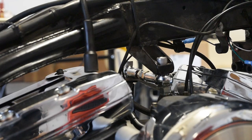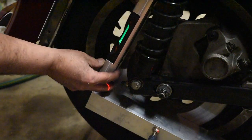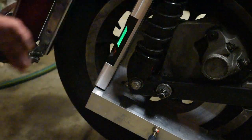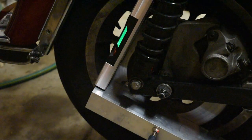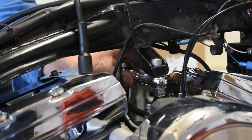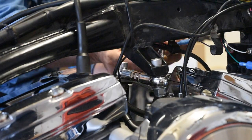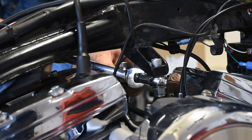Reconnect your top stabilizer, then put the level on top of the bike again to make sure it stayed square. Then put the level on the rear disc and see how it's doing. Now the way these bikes are made, there's really no way it can be off by much at all — mine landed almost perfectly on the money right from the start. If yours is off, go ahead and adjust the top stabilizer as much as you need until you like where the rear wheel's at, then tighten down the jam nuts and this thing is done.